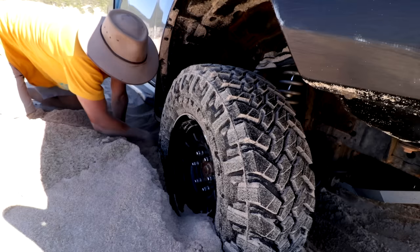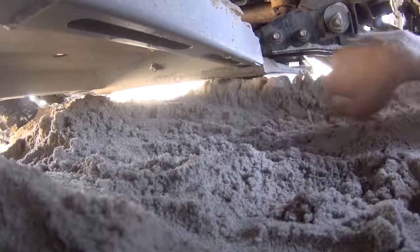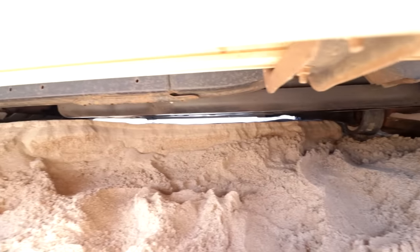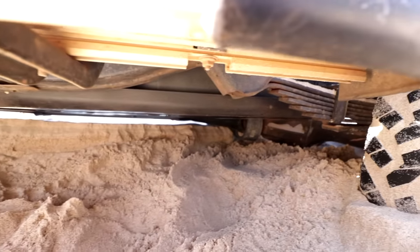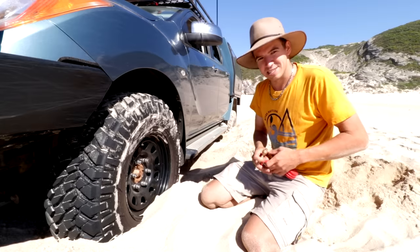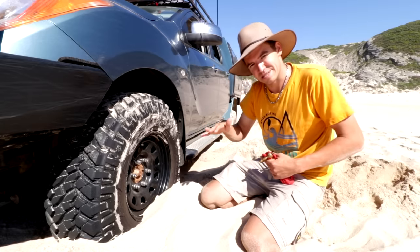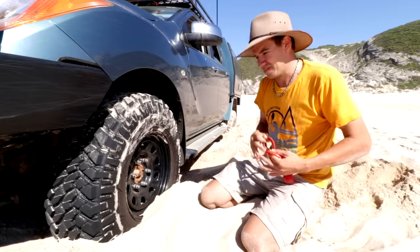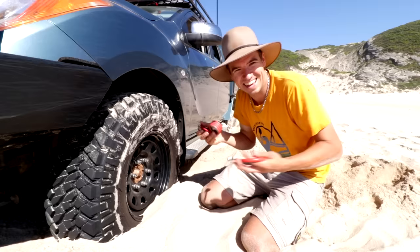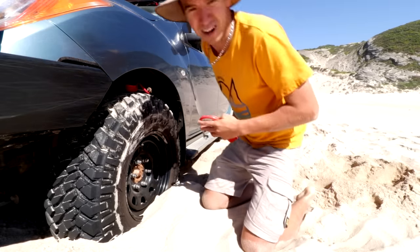This is the last side of the car. Now when you look under the car you can see daylight on the other side all the way under - that's exactly what you want to see, that means the car's on its wheels. At this point it's a good time to drop your tire pressures, because now when the car goes down as you drop the tires it's not going to bottom out all over again. You'd use your tire deflator or a gauge, but in this experiment we said no recovery gear, so I'm kind of cheating using my tire deflator.